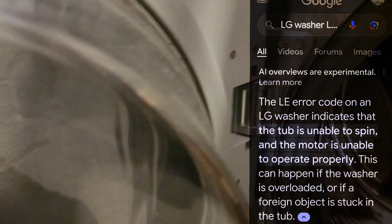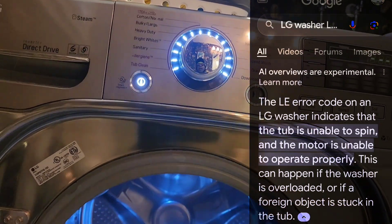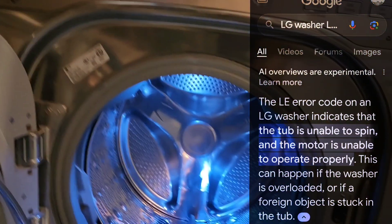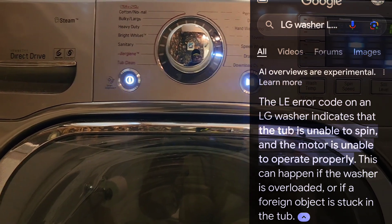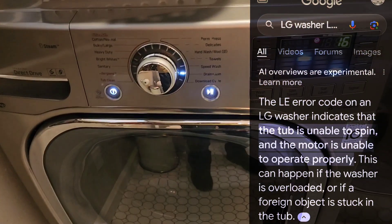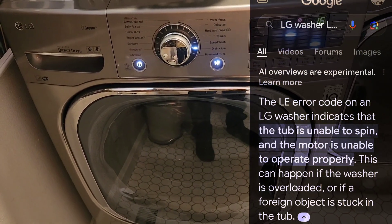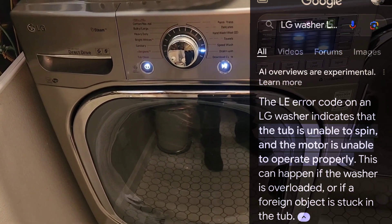I'm going to give you a code removal. I'm going to re-verify the complaint — putting it on, not interested in water entering the unit, only interested in motor action. Set to 16 minutes, re-verify complaint — it should take less than two minutes to duplicate the complaint. On all complaints you want to re-duplicate and verify power to ground to see if you can recreate the error code. If it's displaying an error code, it takes less than a minute for the error code to display.